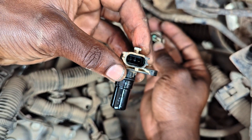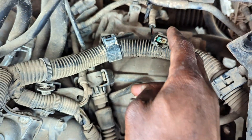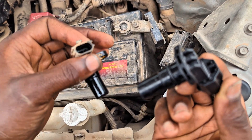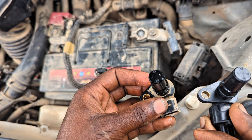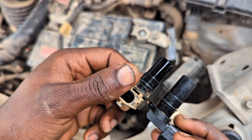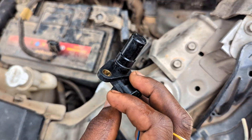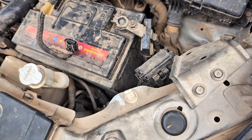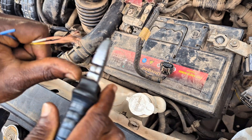The connector was tripping and so was the sensor — one of the pins had broken due to water intrusion inside. Yesterday I disconnected it and saw what had happened. Today I got the replacement part. The owner recently bought the car, so we'll replace the connector. I got a replacement sensor with a socket included; even though the colors don't match, it doesn't matter — I'll use this connector in place of the one spoiled by water.